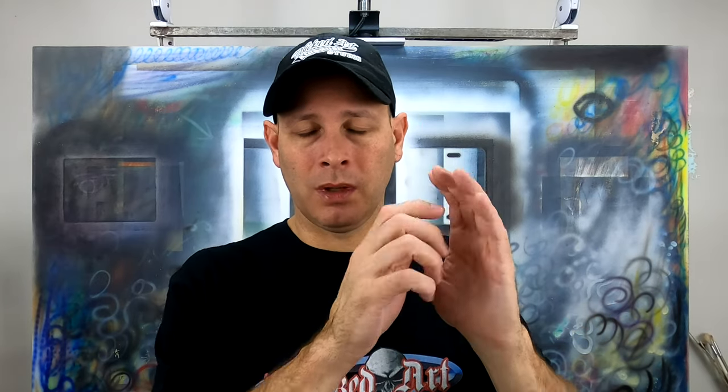I don't mind using 3M automotive refinishing tape any time I'm masking off graphics that I intend to pinstripe around, but I don't necessarily like using it for masked edges where I don't intend to use a pinstripe. For that I've always gone with vinyl tape. Vinyl tape is great especially for curves, but it has pros and cons — one con is it's very easy to stretch it a little too much, and vinyl will always try to retract back to its original position, causing tape lifting around corners or even on straight edges.